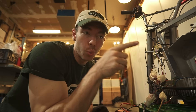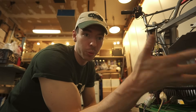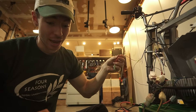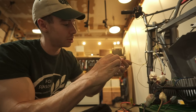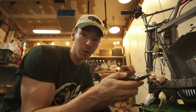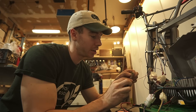What that beeping is — it's trying to identify what motor is in there. When you buy this controller from Electro and Co., they preload the tunes on there, so it should be able to identify this MY1020 motor no problem. It's a really common motor and they specifically have a tune for it. I made the mistake of touching the resistor — it's really hot, so a lot of current is flowing through it. I read online that the controller was having trouble identifying the motor because it wasn't getting full voltage to the power pin, pin number 7. Having a resistor in there probably isn't helping it get full voltage.